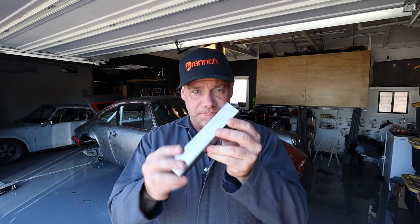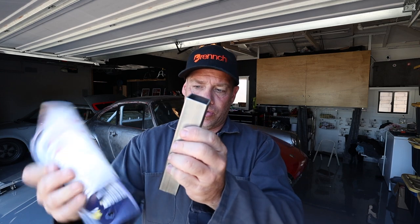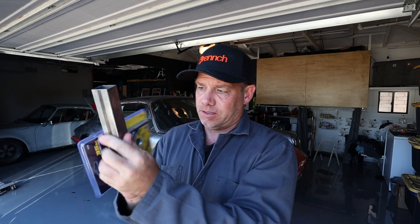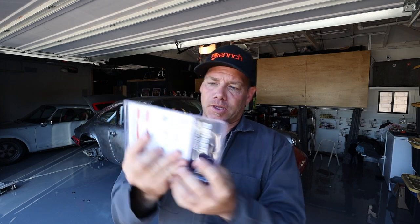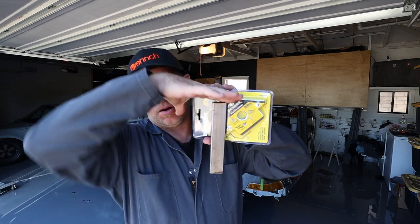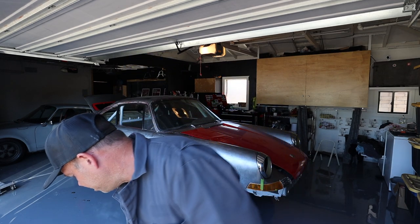Now I've got a couple of these pieces of square 1-inch tubing. And what I wanna do, and this is why I needed the magnet, is I want to affix these to the motor mount, right? So the motor mount is here. These things are here. I'm gonna put a little tack weld. And what I'll have then is these two arms that are coming down this way.